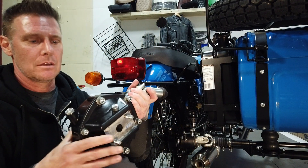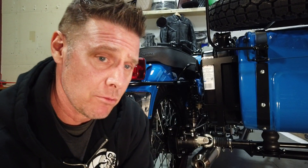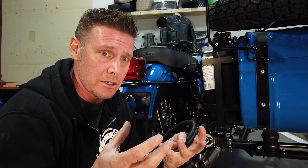One wheel drive is very similar — just a smaller case — with the dipstick here and breather here. So that's why it's imperative to keep the proper levels; get it too full and it's going to try and push out somewhere. Now if you live in an extreme environment like the southwest in the summertime, where ambient temperature is really high and you're pushing it down the freeway at a good clip, even at the proper fluid levels you may get a little bit pushing out because you're really building up pressure from the heat generated by the ring and pinion.